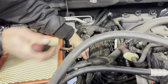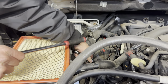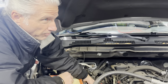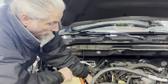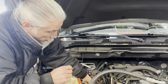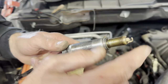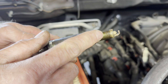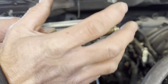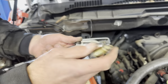This engine is cold. I do believe that these are aluminum heads. You need to be sure that sometimes you need to have these things cold. There are some engines — if you're doing a Ford Triton motor three valve — there are years of that where the spark plugs get stuck. What we'll do is a fuel system cleaning on it first and it will help loosen the carbon up. We get the engine nice and hot, do a fuel system cleaning, get that carbon loosened up, and then take the spark plugs out immediately while the engine's hot. That's an exception — most of the time you want to do it when they're cold.